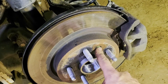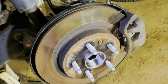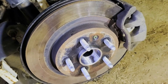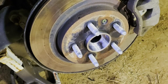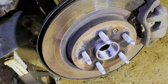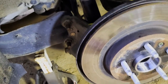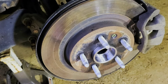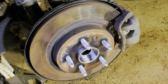I didn't really torque the rotor bolt because it's a captured nut — it just kind of holds the rotor. Even if it backs out, it can't go anywhere; it gets trapped behind the wheel. Just snug it up. You don't want it too tight because it becomes a real bear when you try to replace the rotor. This is pretty much complete as far as the mechanical. I'm going to put the wheel and tire back on, pull the jack stands out, get the scanner back on there, clear the codes, and run it through a drive cycle to make sure the wheel speed is reporting properly.